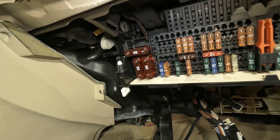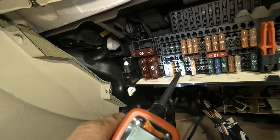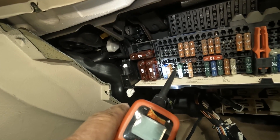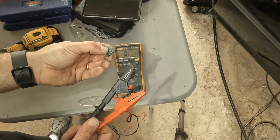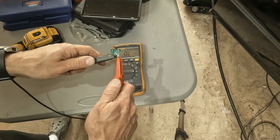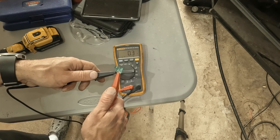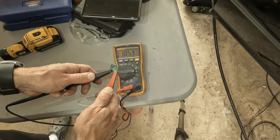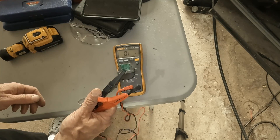What you should be checking with your power probe is that you have power on both sides of the fuse. I should have power here — good — and power here. So that means this fuse is good and it did not open. If you checked one side and it was good but the other had no signal, the fuse could be open. Now it may seem silly to ohm out a fuse, but sometimes a fuse that looks good might not be good. Set your DVOM to ohms and check your fuse. We can see 0.4 ohms through this fuse, so it is actually good. If you saw OL, that means the fuse is open. If you had high resistance or it was jumping around, you have an issue and it should be replaced. So we know our fuse is good.